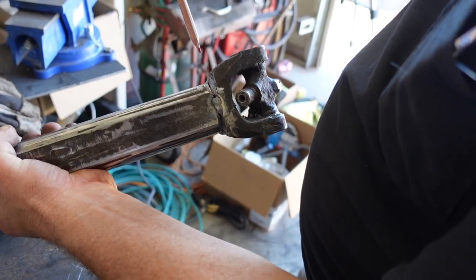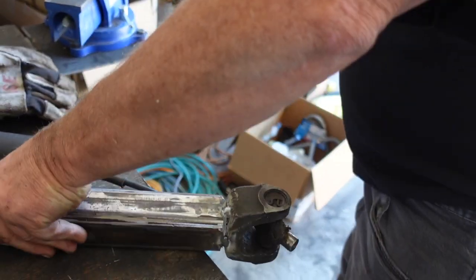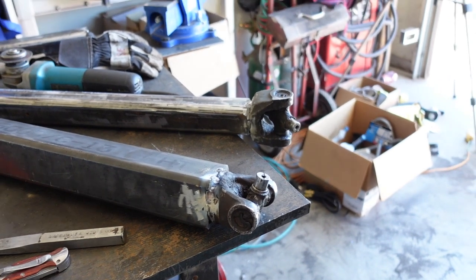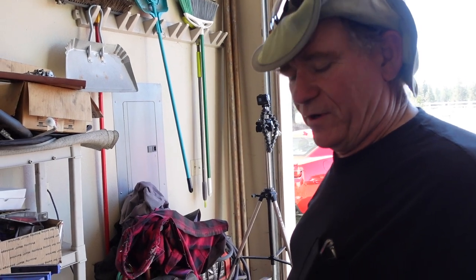There'll be two welds here. Again, one in here, one on top of that. So it's basically two welds, maybe three, whatever it takes. Anyway, that's the process, and that's how you can make a smaller welder work for this. Even if you had a big welder with .035 wire, you'd probably need to do it this way. Or if you're doing it with stick, you'd burn it in with like a 6010, grind all that out,